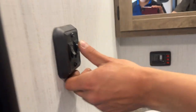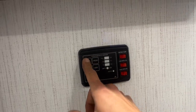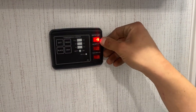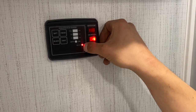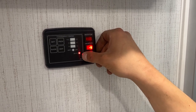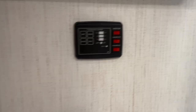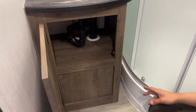Now we'll come up into the bathroom. Light switches are right up on the wall — the one on the left is your light switch, the one on the right is your ceiling fan. For the roof vent just turn that little knob to open it up. There's some cabinet space up top. Right down below you get your monitor panel. In the top left corner you get battery — you can see it's currently charging. Fresh tank: as you fill it up it'll go to a third, two thirds, then full. Same idea for your black and gray tanks. Water pump switch is right there — turn that on and it turns on your water pump, drawing out of your fresh tank to pressurize your lines. Water heater on gas is in the center. As you turn that switch on you get that red light letting you know the ignition sequence has started. It'll try three times — if after the third try it hasn't fired up, that light will stay on. Just turn it off and back on to reset it. Water heater on electricity is down below — just put that on and it fires up with electricity. Your GFCI-protected outlet: test is on the bottom, reset is on top, so if you ever have outlets that don't work that's the first thing you should check.